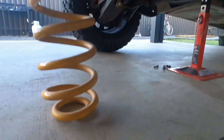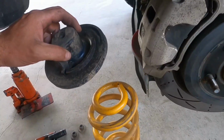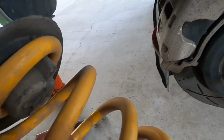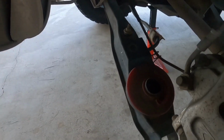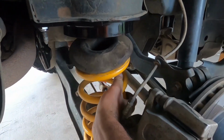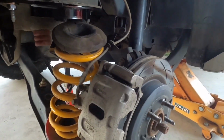You can see your spring, where the spring stops. It's opposite. So I'm taking the Super Pro out. I'm just going to use the factory one. So you put it on the top of the spring, like so. Put your bottom one in. Put your spring back on. Push down. So it's roughly there. Need 2 rounds of this, so I'll put the camera down again.